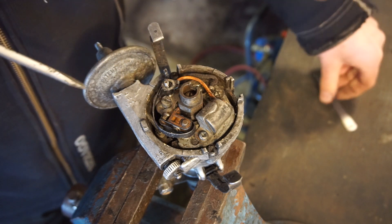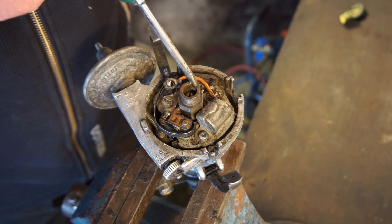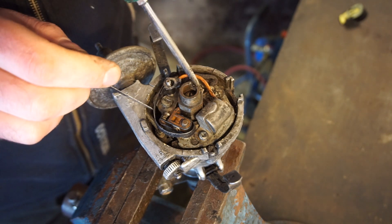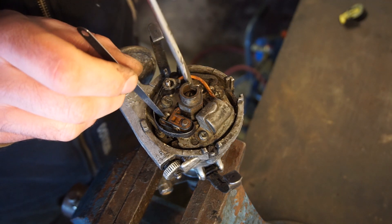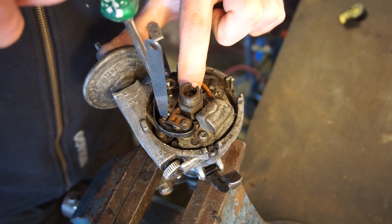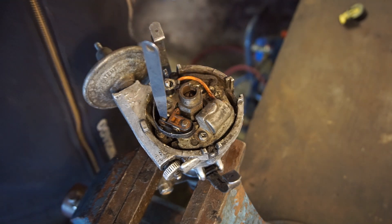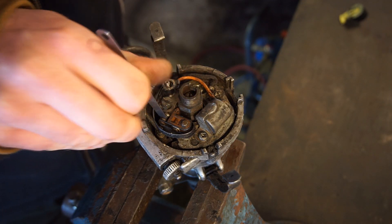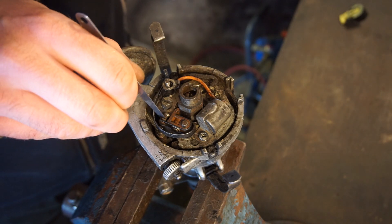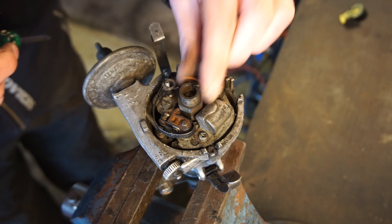So it's really quite simple. You just open that up and on most distributors there's a place here where you can sort of open up the points a little bit. Don't have to open them up too much, just enough so you get the feeler gauge in there. And that will be held in place by itself. Then tighten it down. And as you can see that is better than before - we're now getting some resistance. However it's not too close; there is still a tiny, tiny gap in there. And that's all there is.